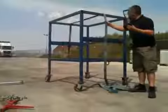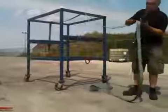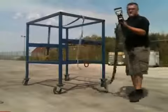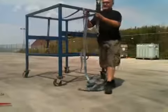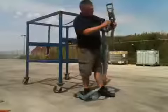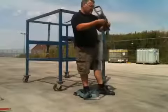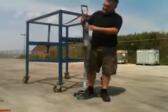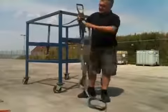So we make sure that it's on correctly and there are no twists or knots etc. in it. It must be kept flat to be able to go through. Now on the ratchet and strap, keep away from the bit with the teeth and we make sure that we can get the strap through the hole in the middle, feeding it through towards the teeth rather than into the teeth. Again, it's a safety issue and it also gives you a good guide on which way you shove it through.